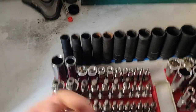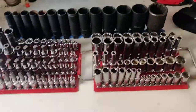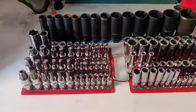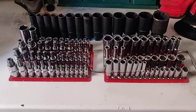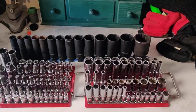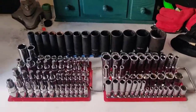There are other specialty sockets like sockets for removing oxygen sensors, track rods, and oil sending units. Unless you're doing that one specific job — your spark plugs are part of servicing, but oxygen sensors you'll only replace when they need it — if you've got to do the job, it's well recommended to get the right socket, because there's no getting a 22mm spanner over them and no getting a 22mm socket over them either because the wire's in the way. The plug is too big to slip the ring end round and you'll never get them out with an open end. They go through so many heat cycles they almost weld themselves in there. It can be a nightmare.